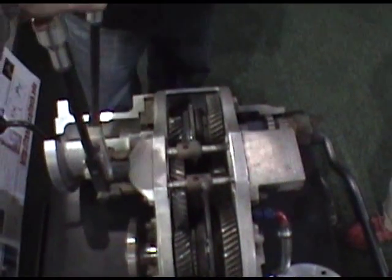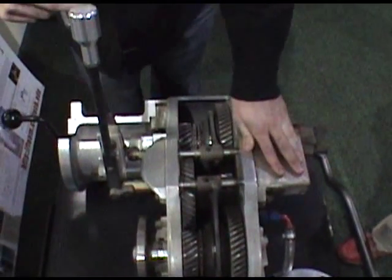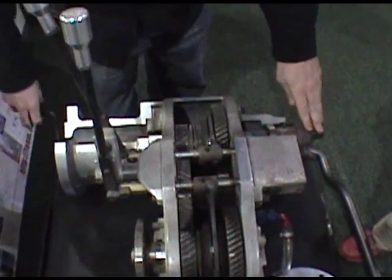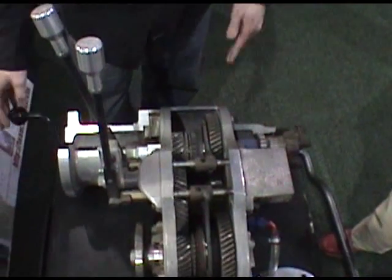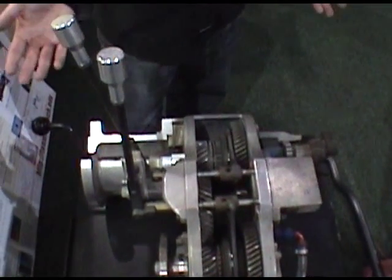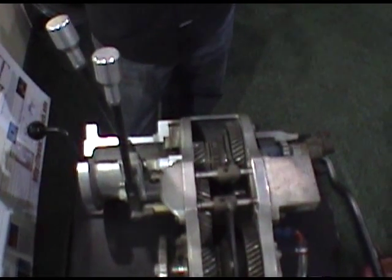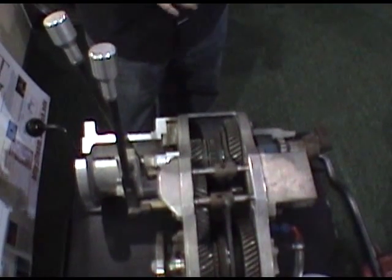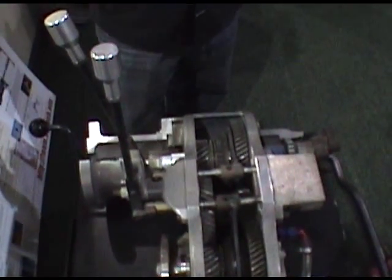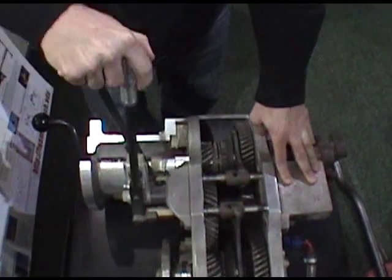The front is here and the rear is here. If we want to go to low range, we put the front back to neutral and then take the rear all the way up into low — there we go. This gives you the ability to go to rear wheel drive low range without necessarily having to go to four wheel low. Right now we're in rear low. I've had people use this dropping boats off at a boat ramp where they don't need four wheel drive but want that lower gear ratio to help pull the boat out. I've also used it during stop-and-go traffic where everybody's going about one mile an hour.